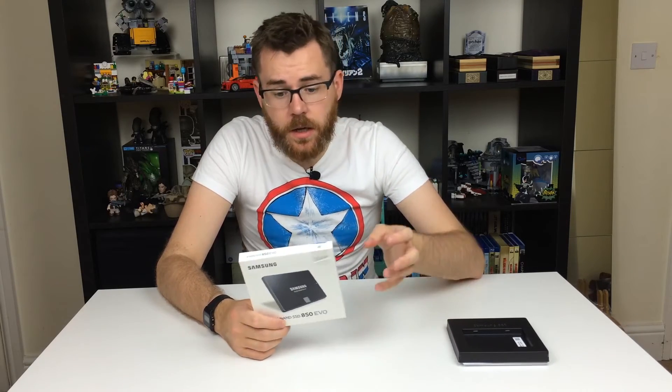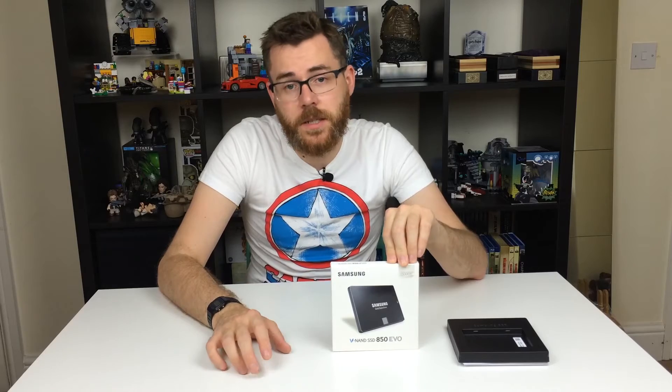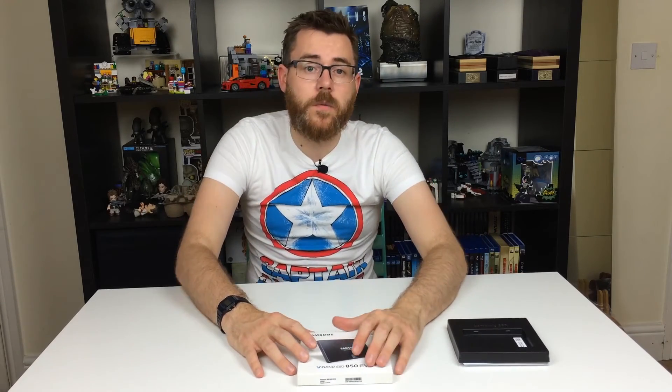I hope you've enjoyed it. There'll be a link to buy this hard drive in the description. My computer is a Dell — they come pre-made so there's not much you can do, but I've got some Fury RAM in there. The reason I went for the hard drive instead of just more RAM is that I already upgraded from 4GB up to 16GB Fury RAM and it didn't make much difference in speed, which is why I went for the hard drive next. So the order you'd want to go through is: do your RAM first, then your hard drive, then look at a graphics card — cheapest to most expensive. Hope you enjoy it, see you next time!